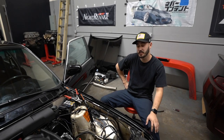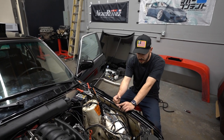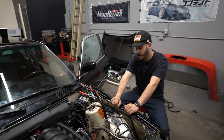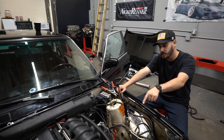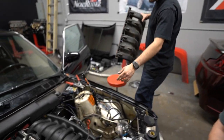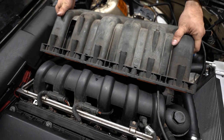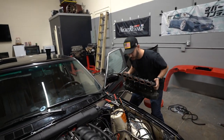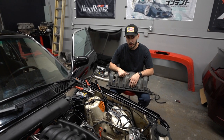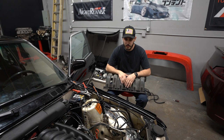I am sending off my ECU to Castle Performance and they're going to be doing the ultimate performance tune, which is the M50 manifold tune — EWS delete, O2 sensor delete, muffler flap delete, a couple of miscellaneous things. It should be a good power gain from stock, but I am going to be running the M52 manifold just for a little bit. I bought this thing like two months ago and I haven't even cleaned it up, but you can see the intake runners here are pretty small. When compared to the M50 manifold, it's 60% bigger — this is probably the best mod you can do for E36s and E46s. I'm assuming it's probably going to be around a little less than 200 horsepower. I know I can do S52 cams which will benefit this mod but that might be until later, maybe when I do the manos or something.